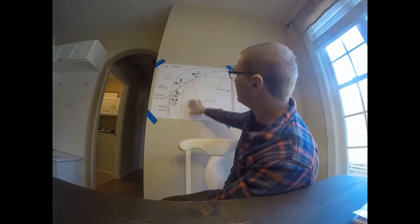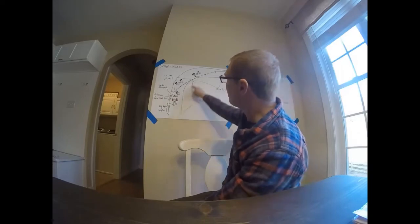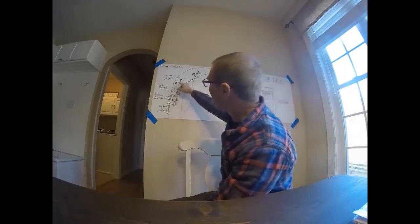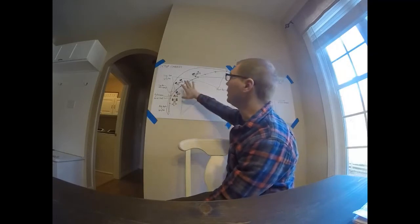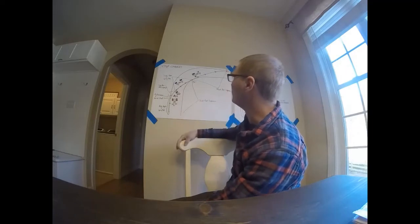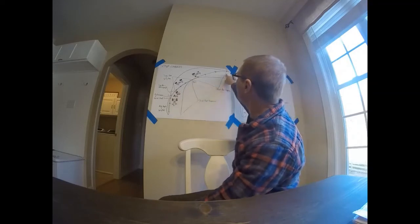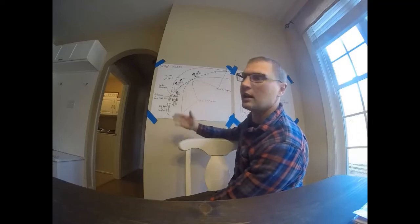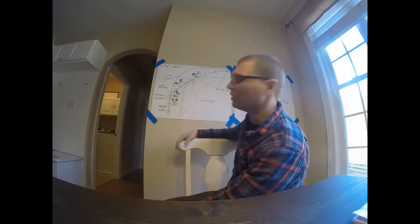To break this down and even oversimplify it from there, braking zone before the apex, think front suspension. Your front tires are really going to be doing most of the work. You're going to get the most bang for your buck going to the front setups first, and then think of the rear setup from there. The rear would be secondary. Coming out of the apex toward track out, think rear suspension. Again, the load's going to be there. Not that the front isn't important. It's just you're not going to get as much bang for your buck there.